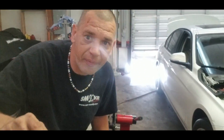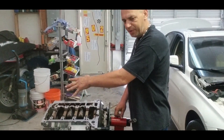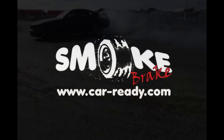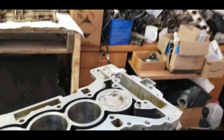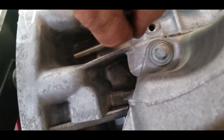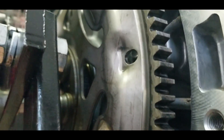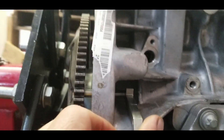Here we are, another day, and we want to start installing the oil pump assembly. The engine is there — turn it around, we need a special tool. We need this pin, I showed you before. It's cylinder number one on top and there's a hole — this pin needs to go here, and on the other side just there. Push it in.